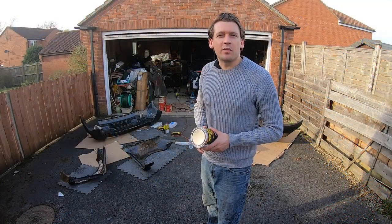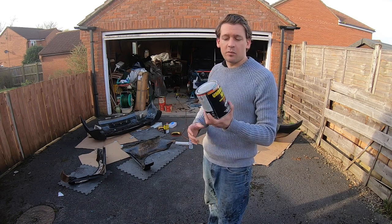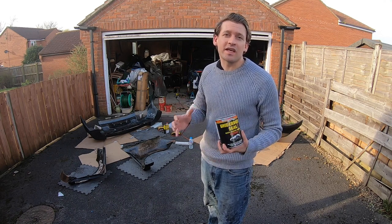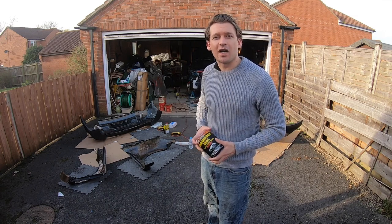Behind me you can see the final parts now curing, and once they're finished I'll do the trim back process on those as well. Once that's all finished and ready to go, I'll put an underbody sealer on the back of every part, the reason being that the wide body kit doesn't come with arch liners and things like that, so they're going to be exposed. So we'll put this on every part and then it'll be ready to reassemble the car.